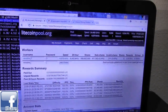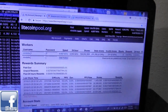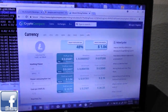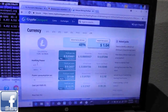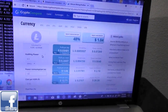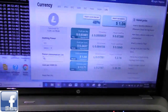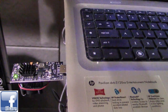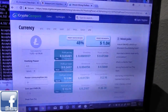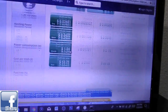That's 0.0006 of a Litecoin per day. The device is currently hashing at about 4.47, averaging around 4.4 megahashes. The power consumed is about 30 watts total — the USB miner itself only consumes 10 watts, but with the laptop you're consuming around 30 watts without the screen on. With a $0.10 cost per kilowatt-hour, this comes out to a certain daily result.